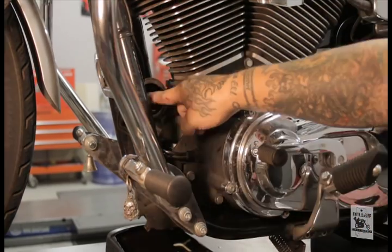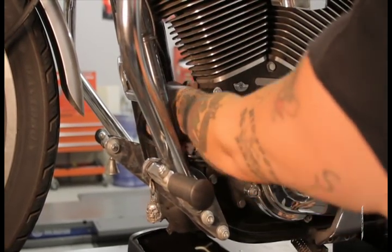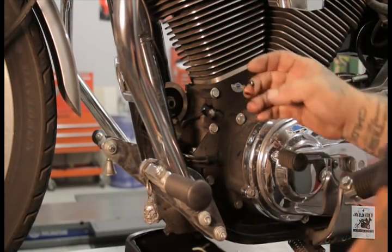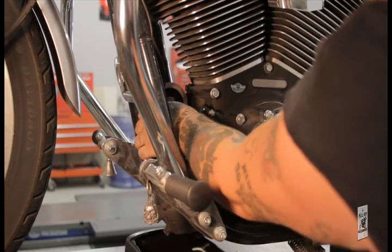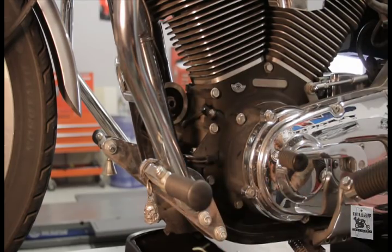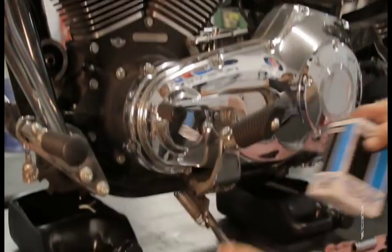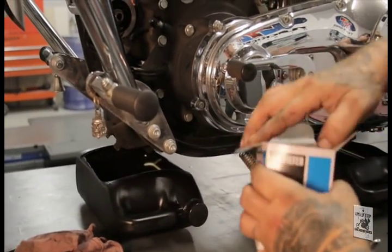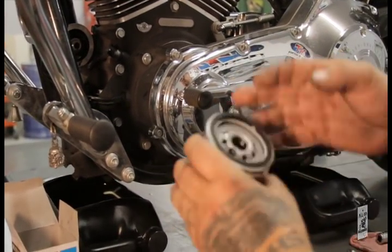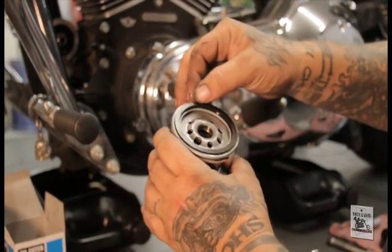Open your filter out and notice the surface. Take a rag and just wipe the surface, then visibly look. Make sure you don't have any trash or residue in the oil filter mount. Wipe the threads off and visibly inspect everything. Open your new filter and visibly inspect it — make sure everything looks good, the rubber O-ring is clean, not gouged or pinched.